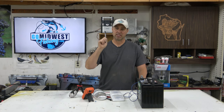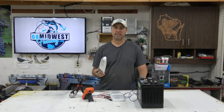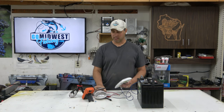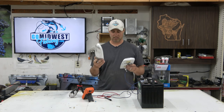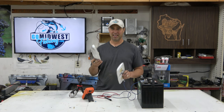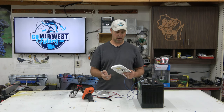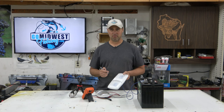Let's do the math for all six lights at once. The old lights are going to draw 198 watts. The new LEDs only draw 33.6 watts — which is exactly the same amount as running just one of the old lights. I can run all six LEDs for the same energy as running one incandescent. If I only run each LED on one side — one bulb — that's 16.8 watts total, which you can run a long time off one of these RV batteries.